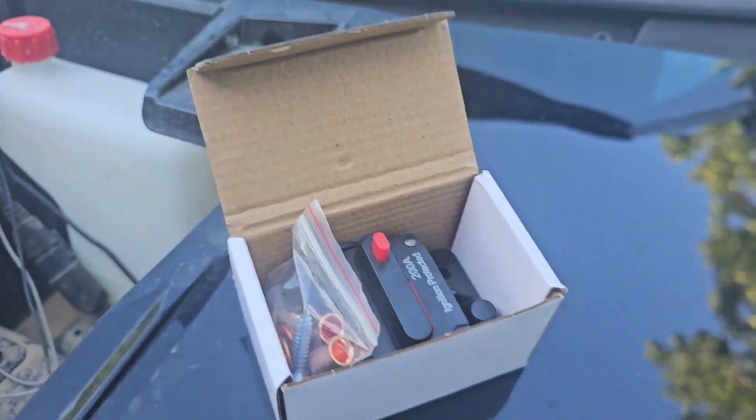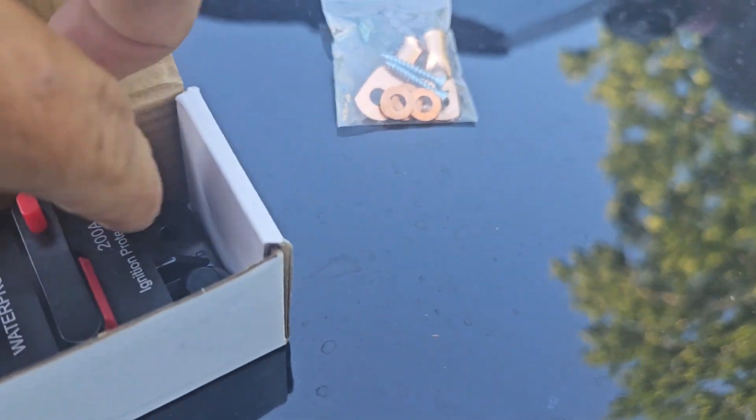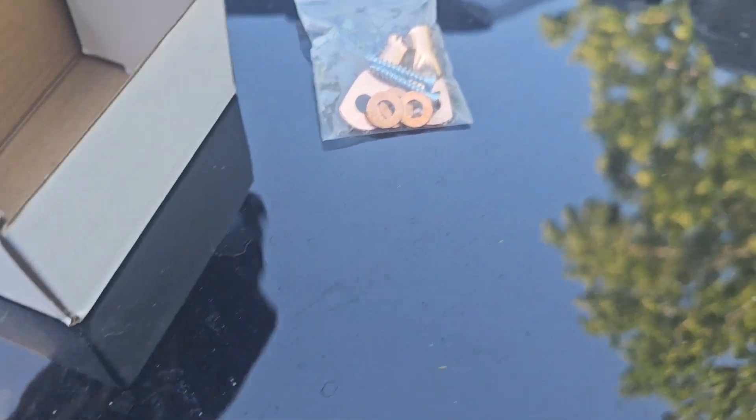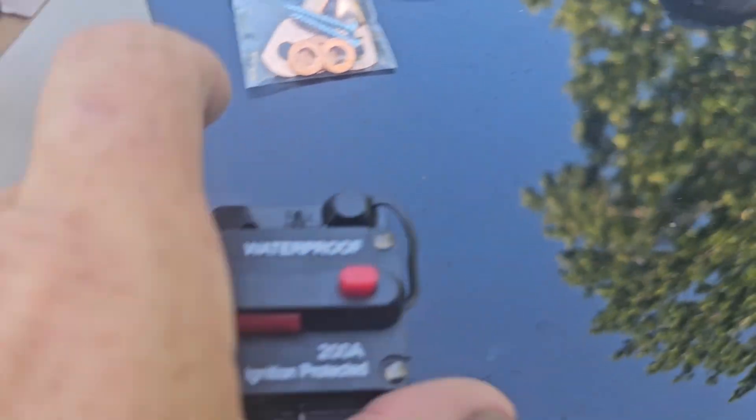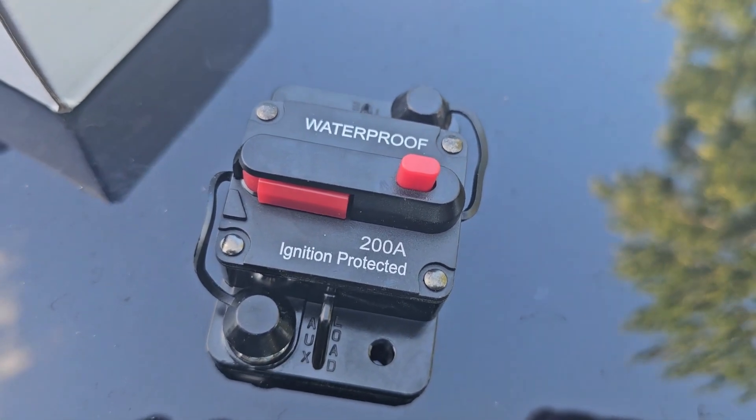So what was suggested was to get a circuit breaker as opposed to a fuse. I found this on Amazon - I'll put a link in the description. It's a 200 amp actual breaker. What I'm going to do - and it's probably not going to be easy - is remove the battery so I have more room to access that line, which there's not a lot of room in there. I'm going to put a circuit breaker in there that is waterproof instead of trying to run a whole new line. We're going to walk through how I do this and see if it works.